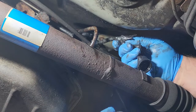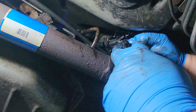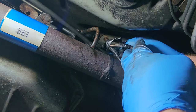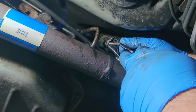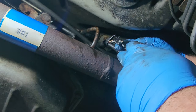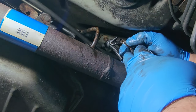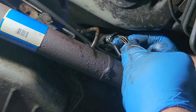All right. Here we go. This harness comes from above. And let me show you the band-aid I put on when I first got this Jeep. You can see this electrical tape wrapped around and it got funky pretty fast. So let's unwrap this. I tried to isolate the wires as best I could because they were all exposed and touching, and clearly it didn't take, because I got a short or something. Whatever caused that check engine light was not an effective fix.